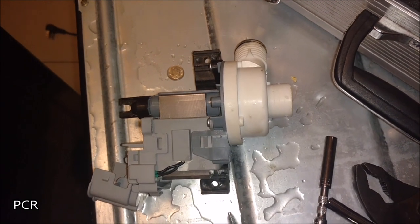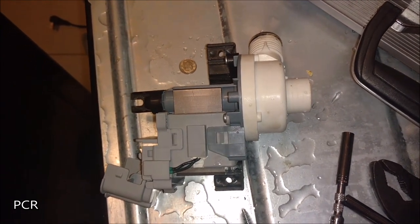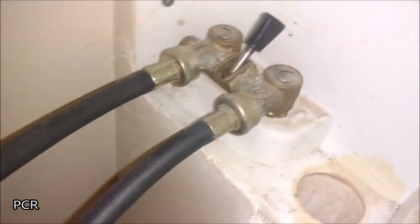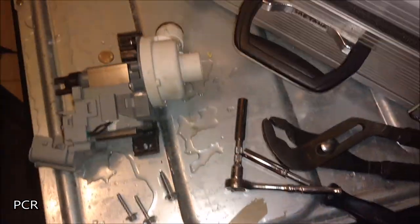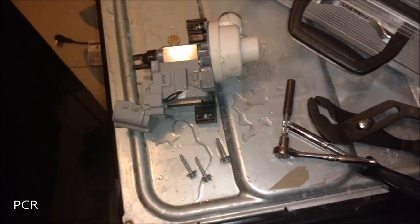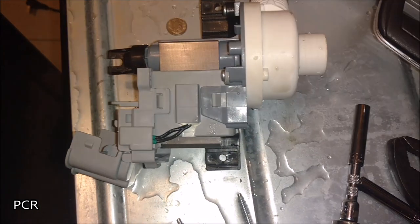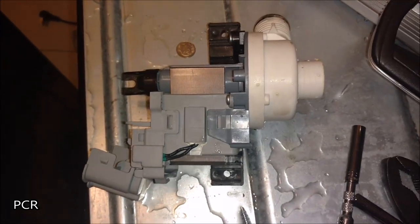Don't call a repairman — you can do this yourself. The only part that's actually hard about this is, if you're not large in stature, trying to get the washing machine on its face. Set down a towel, make sure it's unplugged, and the hoses are out of the wall. Make sure you remember which one goes where if it's not labeled. Not hard to do — save yourself some money, just do it yourself.